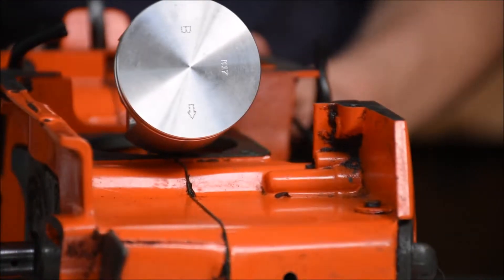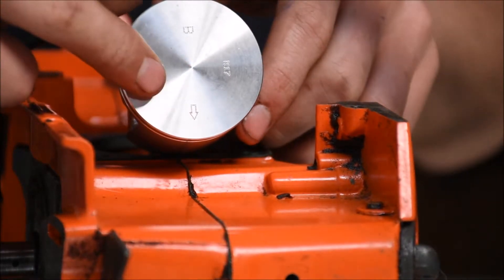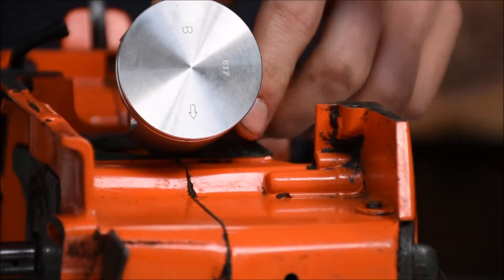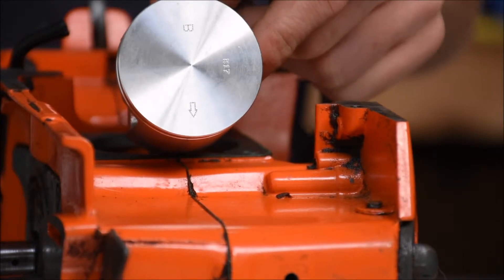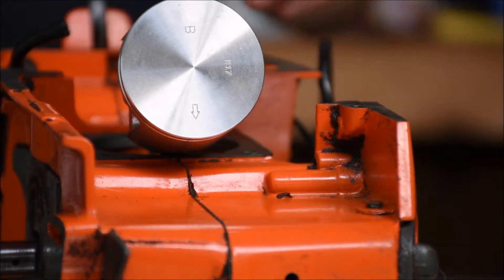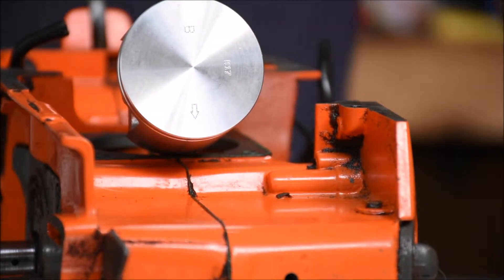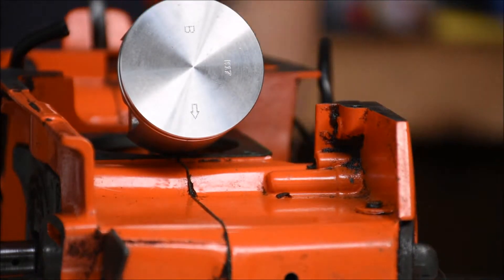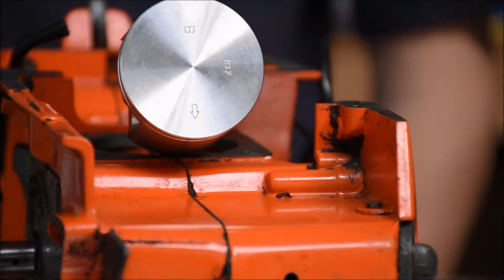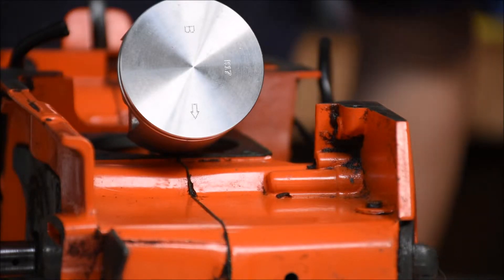Something I forgot to tell you to check: when you're putting your piston in, there's a little arrow on the top. Just make sure that it's pointing to where your exhaust port is. On this saw the exhaust port comes out the front, so as I installed it I made sure it was pointing to the front. Otherwise the piston's quite possibly not going to fit right — the rings aren't going to orientate right and it's not going to be good.